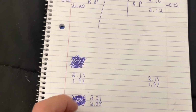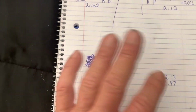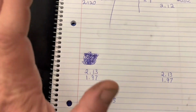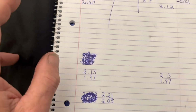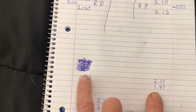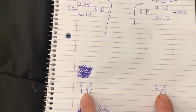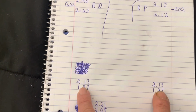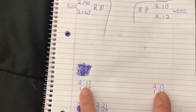So it's too dark to do anything further with the vehicle today. So I'm going to go back out there tomorrow, ratchet strap the steering wheel in place so that it doesn't turn when I'm doing my front toe adjustment. Get my front toe adjustment set to these numbers, and that'll get me at exactly 10 minutes of positive toe, plus minus nothing.